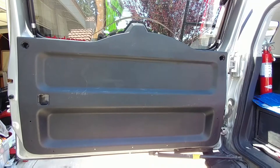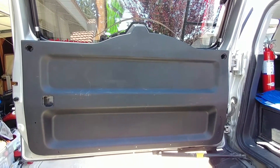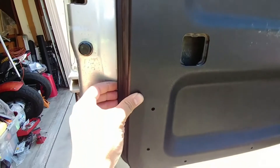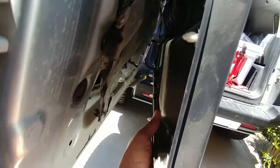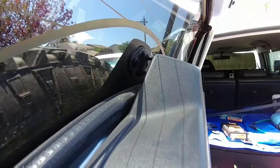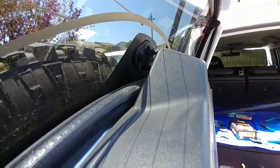This will allow you to attach any rack covers or accessories. In order to pull off the panel, grab it from the back here. You're going to reach your fingers in and then pry outwards, and slowly pull along the bottom — they're just held in by tabs. Lastly, you'll have to open the rear window hatch in order to release the plastic cover.